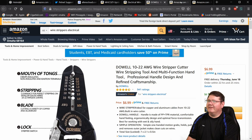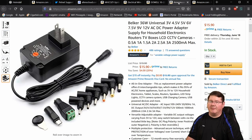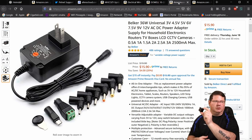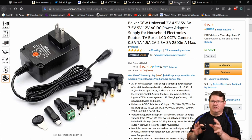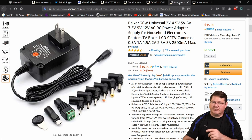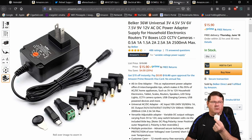When you wire directly to the motor, you're bypassing all of the PetNet electronics, including their battery. The PetNet device comes with a little wall wart — 5 volts, 1 amp — and when you wire directly to the motor with this Wi-Fi device, it's not enough amps to run the motor correctly. One option is to use the wire that came with the device and plug in one of those Apple iPad plugs if you have one lying around and don't mind dedicating it to this use — it has enough power.